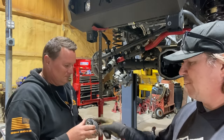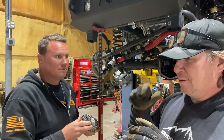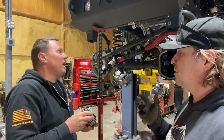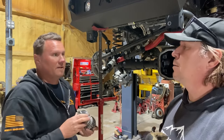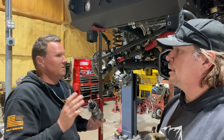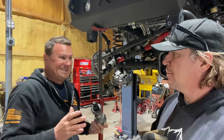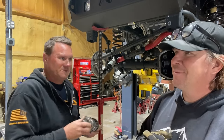So you basically would change that flange or yoke, put the new one on, and then tighten it and try to get back to the 24 if you haven't really driven it much. Well, you won't be able to measure that 24 because you're already going to have the ring gear back in there. So you're just going off of experience. Okay. Yeah. So, like I said, it's not rocket surgery. Just don't crank on it.